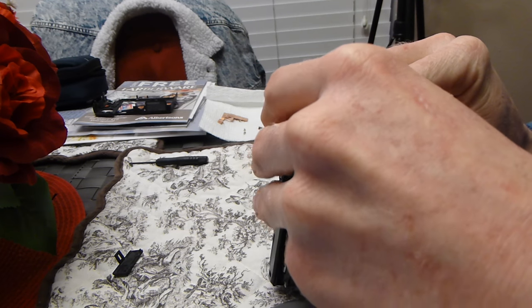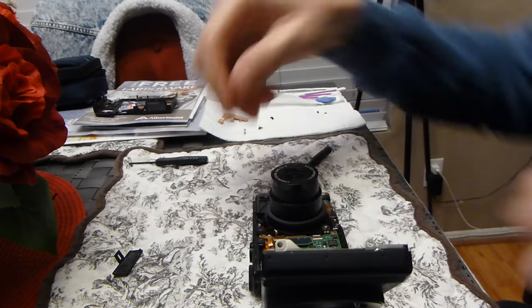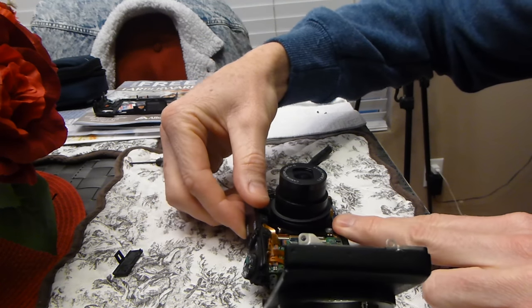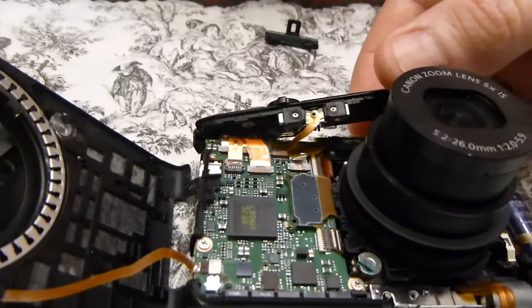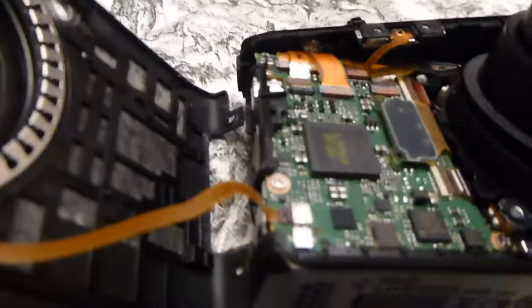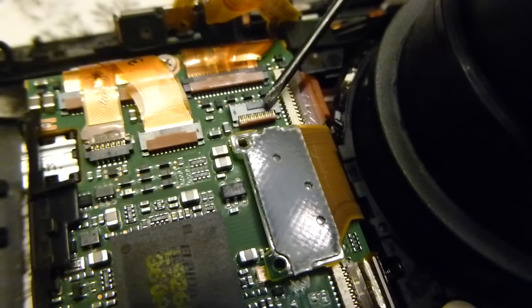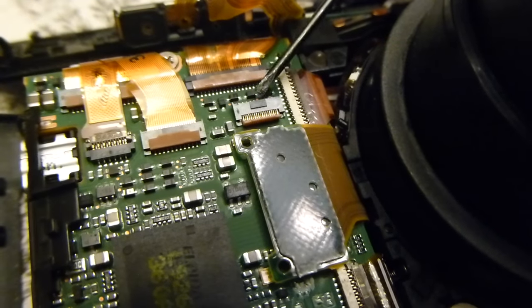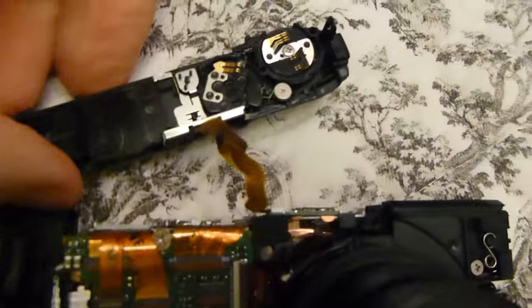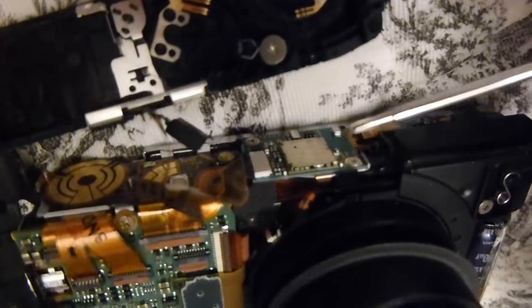The front plate is still on with that cable, so we need to be careful. With the second screw removed, the top comes up — but remember we are connected by a little ribbon cable right there, so we need to be careful. It does unclip right here, so we'll need to unclip that to remove it completely. Those just flip up just like other types of releases — be very gentle with those clasps that tighten down the flex cables. This little tab flips from the back of the camera up forward, and then the little flex ribbon slides right out. Now come up to the top — there's a small green chipboard for the other end of the flex cable, and two screws on that. Remove it, remember the layout, and remove that top portion altogether. It's removed and set aside.